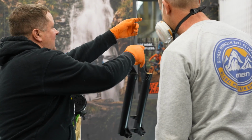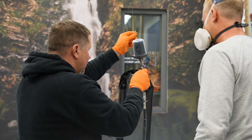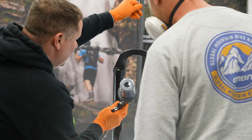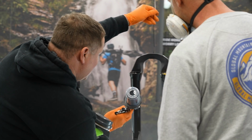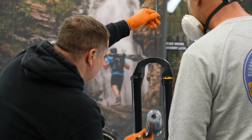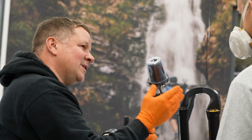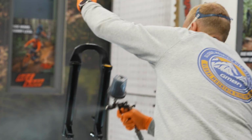Just by holding this, try and do this area. So just in case there's any dust got in here, just give it a blow. And then in here, just be spinning. I'll do it away from it, but you'll be painting this like that. So literally one fluid motion, but remember, don't stop until the paint's off of the job. Don't stop here because you'll never stop painting at the same time as you stop moving, so you end up with that heavy spot of paint.